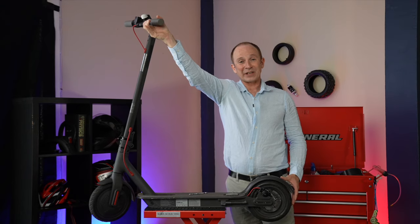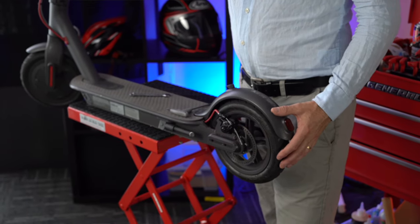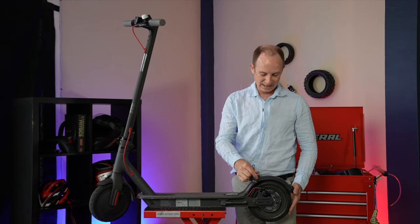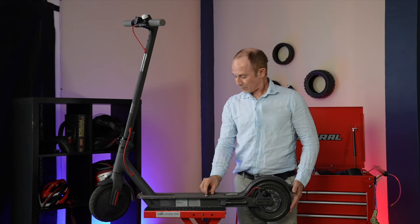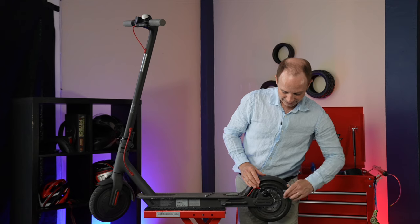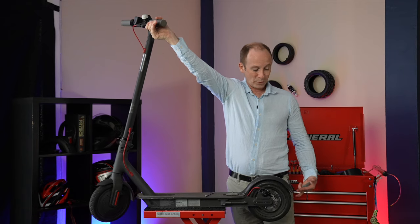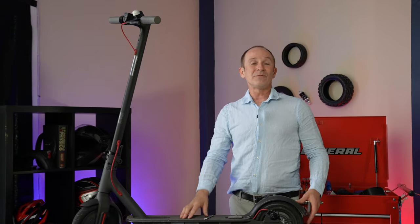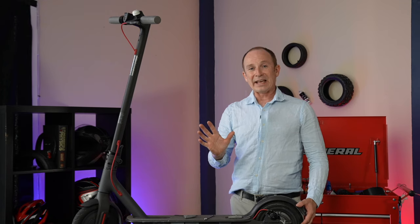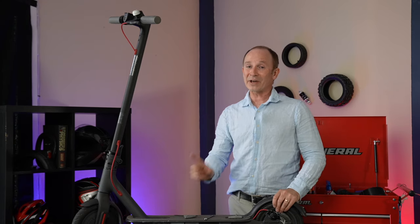Make sure that you've got it adjusted so your brakes are on and your brake light is on at the same time. On most scooters this won't be a problem. Once everything's working, lock down your lock nut. Double check to make sure the grub screw on the rear pad is also locked down. Check one more time for brake drag and for your brake light, and you're good to go. If you're still getting a lot of drag, or a rubbing that's happening once per turn and you can't seem to get it adjusted to the right place, you may have a bent brake rotor, and we've got another video for that. Thanks for watching, and let us know in the comments what repairs you'd like to see us take on next.